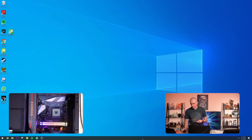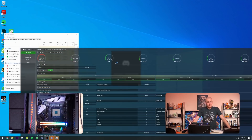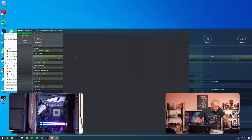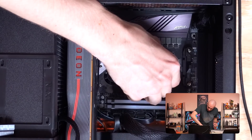That's the general idea. I realize now I should get a baseline of it having no processor on it, but I'm not doing that. We're booting into Windows right now - everything's fine. Let's pull up AMD Ryzen Master and see what the temperatures are currently like with the 3700X cooling it. Currently we are at 95 degrees Celsius before anything's happening. Let's run Cinebench - we're at 103, 105, 107 - thermal limit is 95. It's just climbing. 112 and we couldn't even get a Cinebench run in.